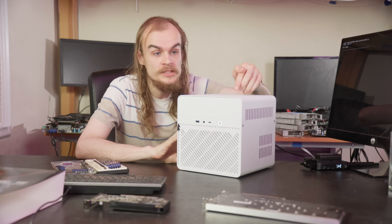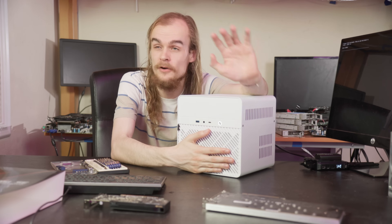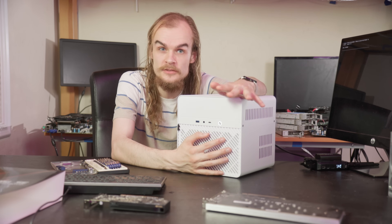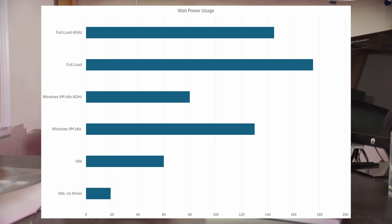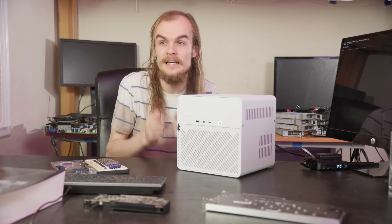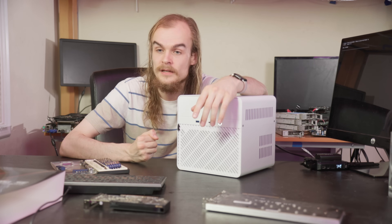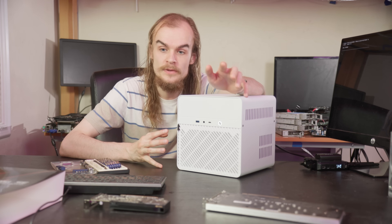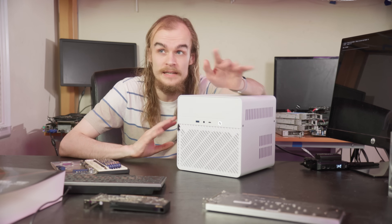I was thinking: no chipset, mobile CPU — ultra low power consumption? Let's see. Testing without and with drives, the mechanical hard drives are by far the most power hungry part at idle. With Proxmox installed and the web page being accessed, the system pulls about 19 watts from the wall. With 5 three-terabyte 7200 RPM drives plugged in, that goes up to about 60 watts. Here's where I noticed a quirk of many modern CPUs: when you start doing tasks like running a VM with a few background tasks, the CPU ramps clock speed up to its maximum of just over 5.4 GHz and does them quickly, but pulls a good amount of power. With a Windows VM running at its desktop, it goes to about 130 watts.